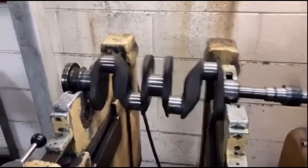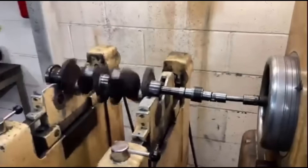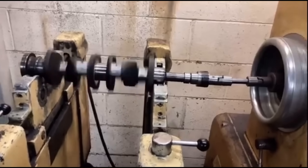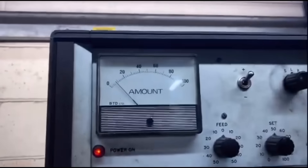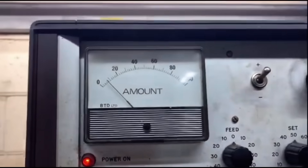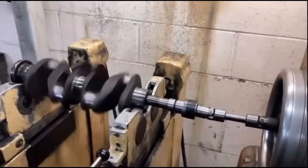So I've got the Midget crank on the balancer here and as you can see it's about 20 out, although it is supposedly already balanced - so whether somebody's made a bit of an error or what, I don't know, but we're going to have to get that balanced again and check the rear end. The rear end is quite good, still a little bit out - about 5, between 5 and 10. So we'll get that balanced and then check the front pulley, flywheel and clutch as well.